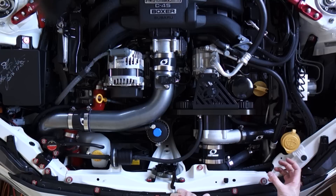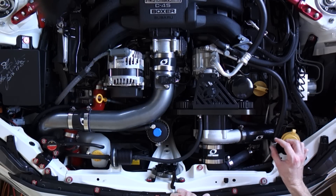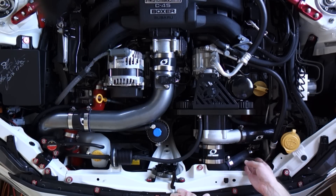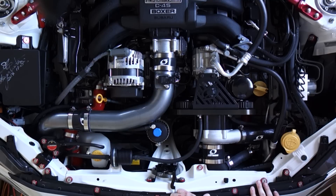The idea when you're setting it up is to set the spring pressure exactly right so that the valve closes just as the car is returning to idle. I can't really show you on this car but what I can show you is a clip from my old WRX showing you exactly how that valve behaves as you're returning to idle.